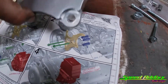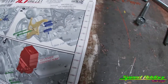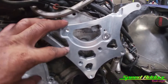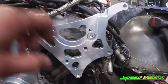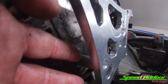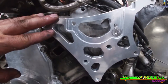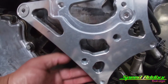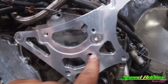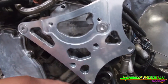Alright, looks like step two — we're going to be using this second gold bracket, two of the 120 millimeter bolts, and then we also got three more spacers, which looks like they're the last three spacers. A little tip when installing this particular kit: you got the spacers behind these two bolts, and then they want you to put the spacers behind there with no bolts holding them. What I figured out is run these two bolts in almost all the way, then take your hand, set that one spacer there, tighten that one up, put force on that side, and then repeat the same process on this side. Put that spacer back behind there, tighten that up, and as you can tell, they're staying in place.